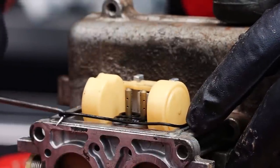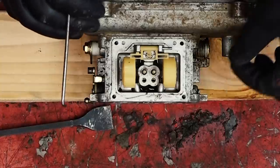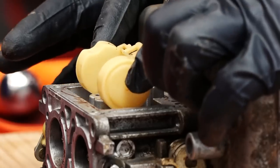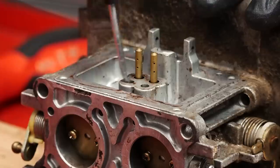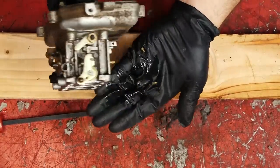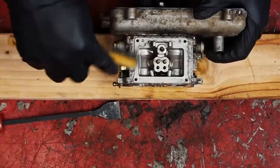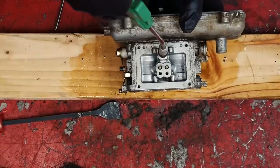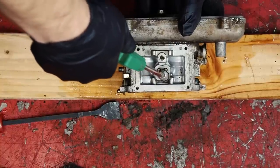Now we're going to remove our old gasket and replace it with a new one. To get out the old float and seat, it's just held in place with that one pin — simply remove it and the float and seat will come right out. Now we're going to remove our two pilot jets using a flathead screwdriver. Now we're going to start cleaning the inside of the carburetor — spray cleaner in all the passages, scrub out the dirt, then blow them out with air. Make sure you put air in each one of the passages to blow out any little bit of dirt that may be stuck.